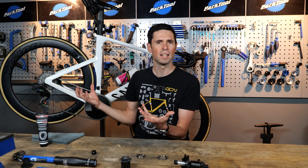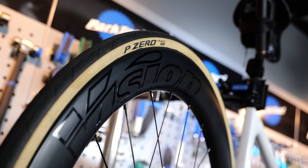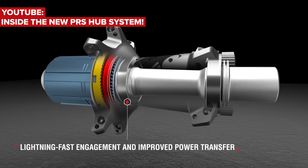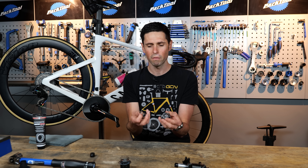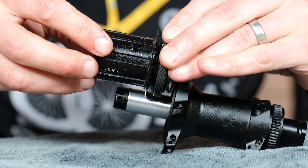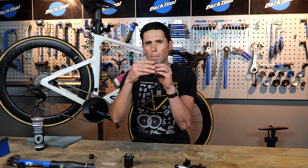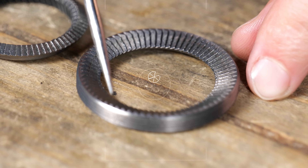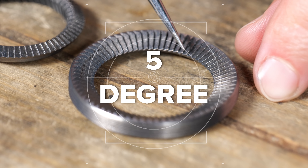The examples I've got here today are from Vision, one of our wheel sponsors here at GCN Tech. The system they use is called the PRS, Power Ratchet System. There are a couple of unique designs here which make this system different. One of those being a neat helical gear fitted to the freehub body, which when you engage drive through the cassette helps to pull everything together for a secure engagement. This latest design also has 72 teeth to it, giving a five-degree engagement.